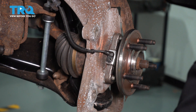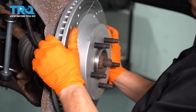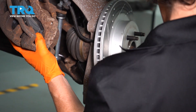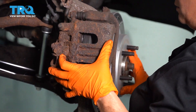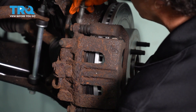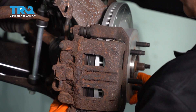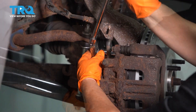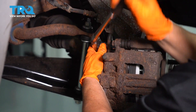Grab the caliper mounting bolts and get them handy. Take the caliper off the hanger, slide the pads right down, and get one of the mounting bolts started. Make sure you slide it in by hand first — that's the 18-millimeter socket. I'm just going to snug them up and then I'll get the factory torques and torque the caliper bracket to knuckle.